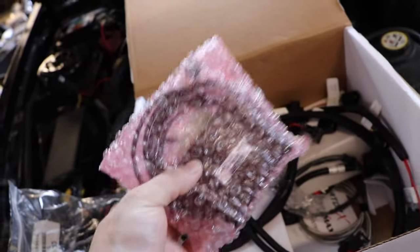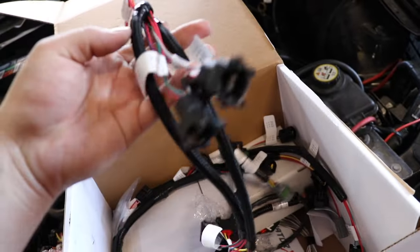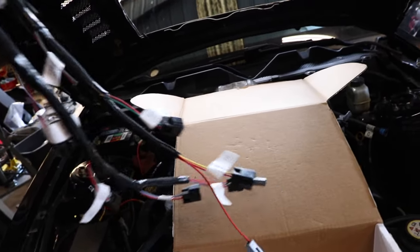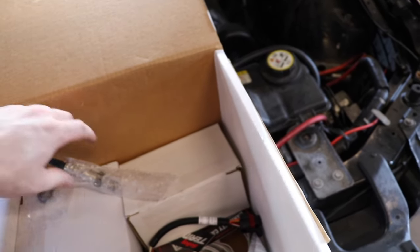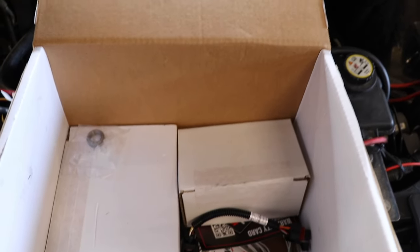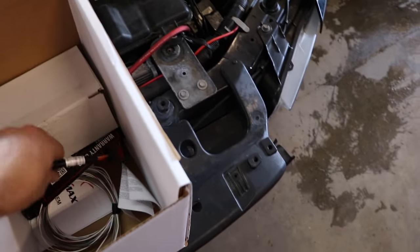These do offer some kind of plug-and-play tuning options. You should be tuning in advance, not simple. Looks like we got the injector harness EV1 right there, the coil harness. We should have plenty of room to reach all these coils down here. We got the wideband included. These widebands work great — these closed-loop systems work really really good. We are just running a single wideband on this even though there are two banks, but I think we'll be good to go there.